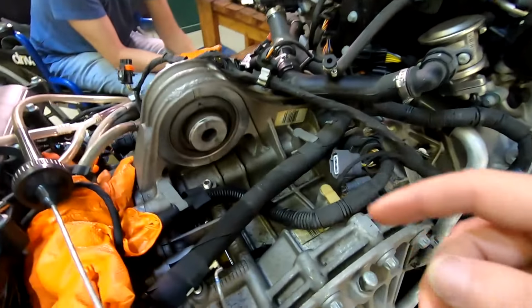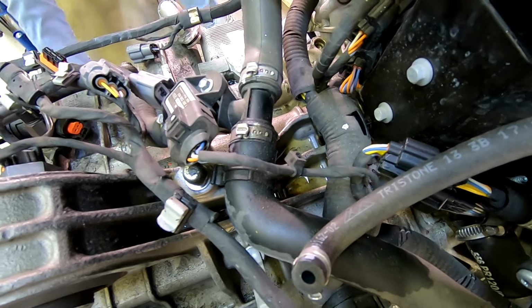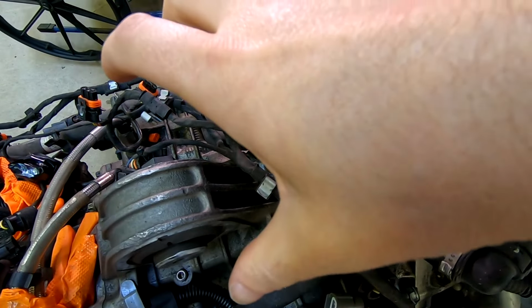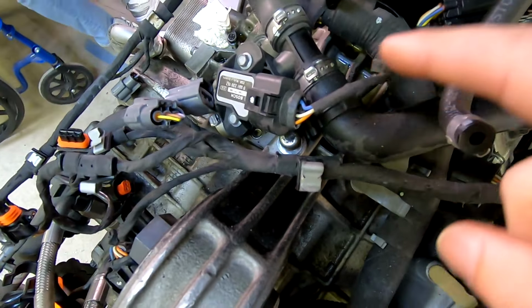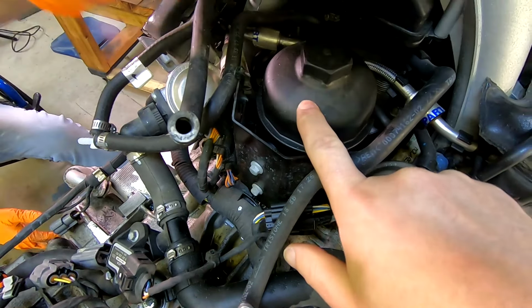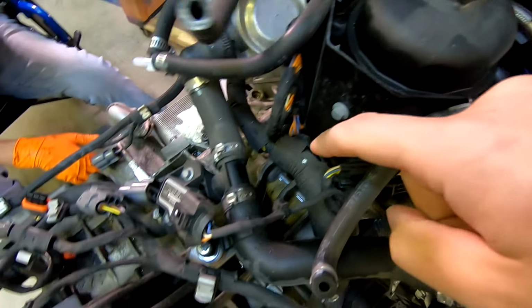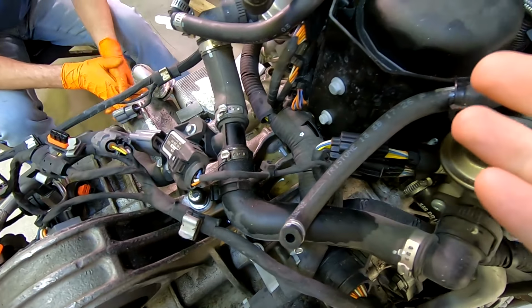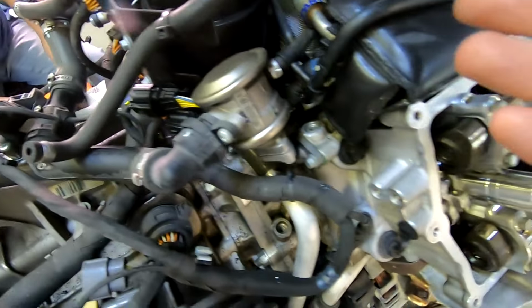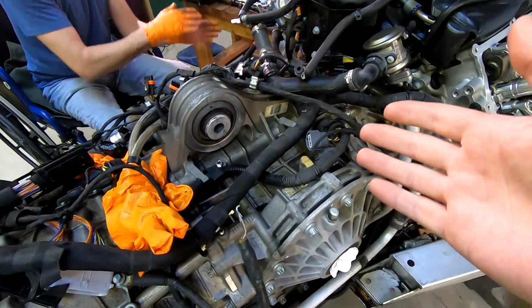We noticed some pools of fluid. This one over here happens to be directly under that hydraulic line, so when we disconnected that, it's very possible that some of that dripped down onto here. But then we also have some pools up here in the middle, and the coolant reservoir is sitting right above this, so you wouldn't see it if you happened to spill any down there. We just don't know how it would get there. Here is where the engine oil filter is. If you tried pre-filling the filter and then tipped it over, it would just dump out, and it's possible that could be from that. But back here, that doesn't exactly explain it. So we're not exactly sure where this oil mess is coming from, but it's all over this half. We're still investigating that, but that's where we're at in regards to the mess and random oil.